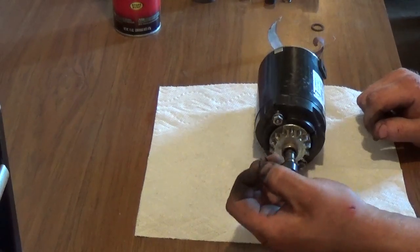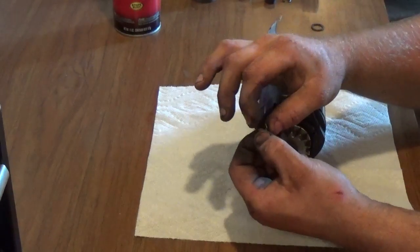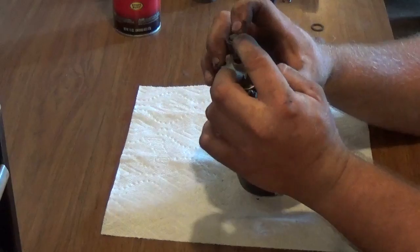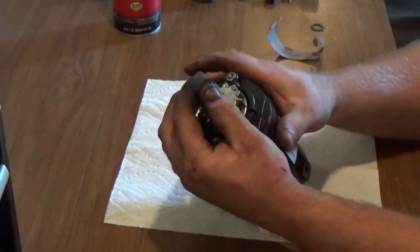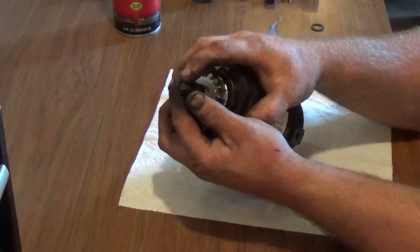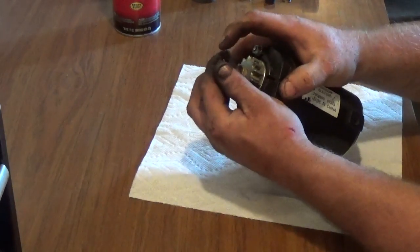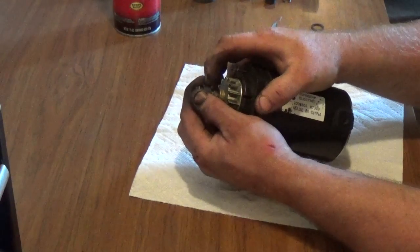Now, guys, you can take a pair of pliers and a 10mm socket after you push this back together to make it tight. Put it right on top and hit it with a hammer and it'll drive it straight on. You shouldn't have any issues. The nice thing about these starters is that after you push it on, if you feel like it's not retained good enough in the groove, which I'll try to show you here next to my finger, this groove, you can simply take a pair of pliers or even channel locks and just squeeze it once it's inside the groove to make sure that this keeper is going to lock over it.